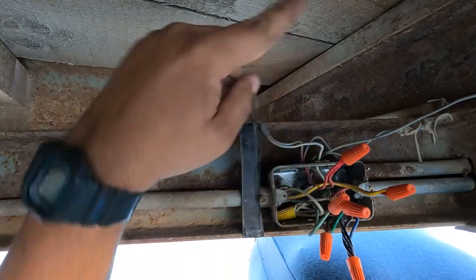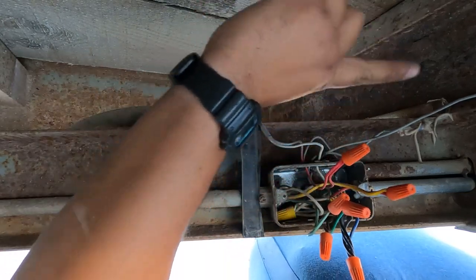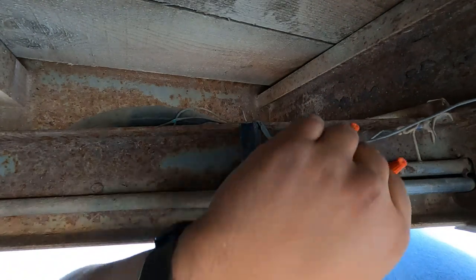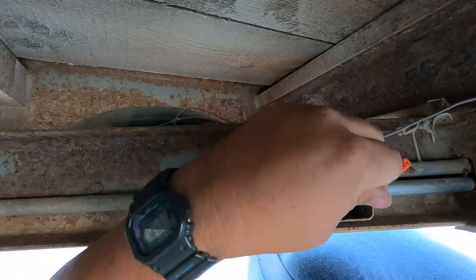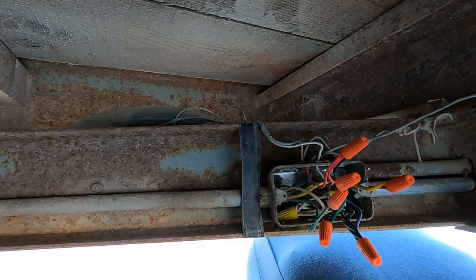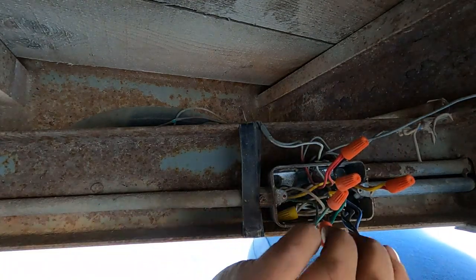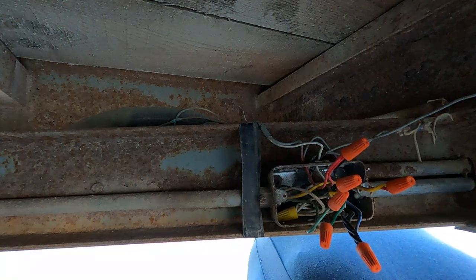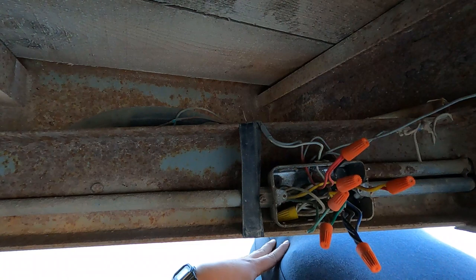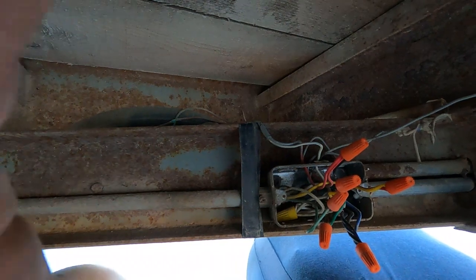The other red wire is going up to the breakaway, and then the wire coming back from the breakaway should be tied in with my brake wiring here to energize those in the case of, you know, if the pin gets pulled. So we'll just go fix those 2 wires on the breakaway, hook our box up, and test some stuff out here.